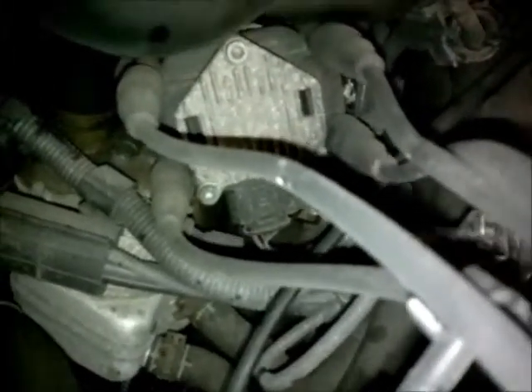What we're going to do is unplug these individually — as we take one out we put one on, that way we can't get them mixed up. There is our coil where our plug leads plug into. So plug one out, plug one in — you can't get them mixed up. Or you could mark them one, two, three, four and plug them back in one, two, three, four.